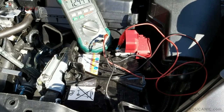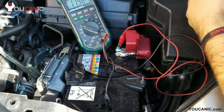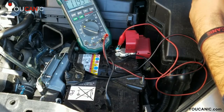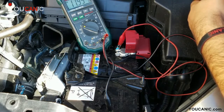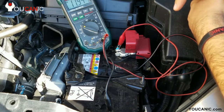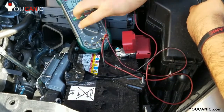If your car battery has died, the best way to bring it back to life is to use a trickle charger or slow charger, which produces anywhere from 2 amp to 5, 10, or 12 amp — a very small current. These are also smart chargers, so at first they'll put maximum current on the battery to charge it, and then as the battery reaches around 80% to 90%, they just reduce that current to ensure the battery is not charged too fast.